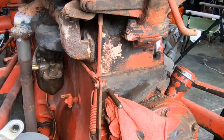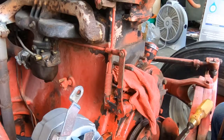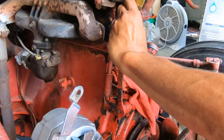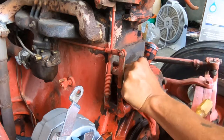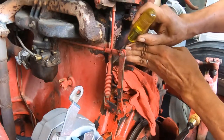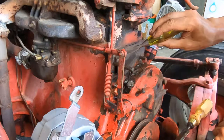I'm wondering if I can get this linkage off without too much of a hassle. I really don't want to disassemble the whole tractor again, but this part's going to be hard to get at. I'll try a smaller chisel on there. Yeah, that's working fine. It came off real easy, which — that's where it was leaking. I was right, right in this area.